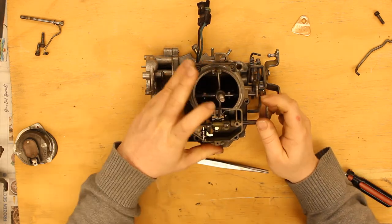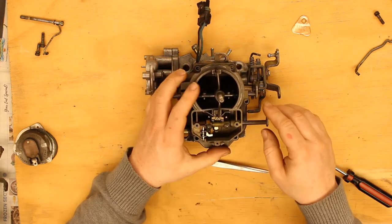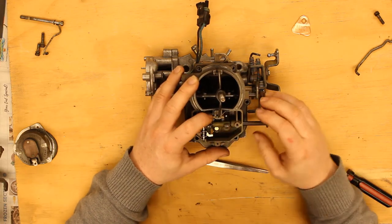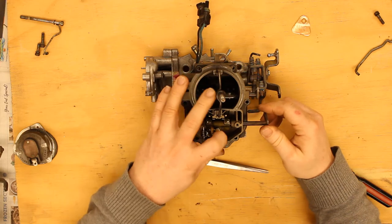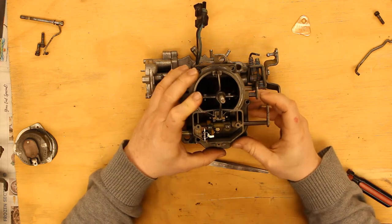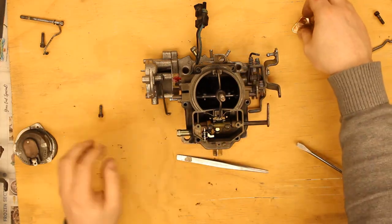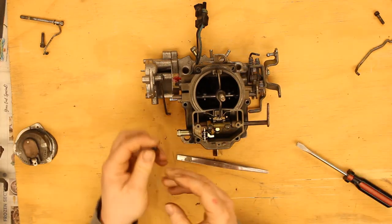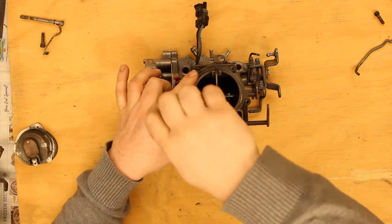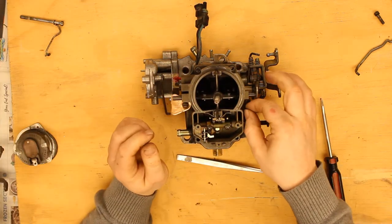This is normal. If you're working on these, this little lever right here is actually the carb vent. Sometimes if you over-exert it, it'll pop over and won't go back down — don't worry. Just lift it up and there you go. Now I'll take two more carb screws and put the middle screws back in, so those pins will stay seated and the gasket will stop shifting around.